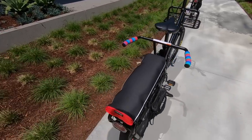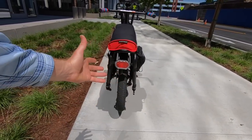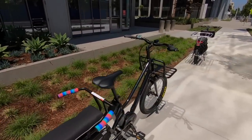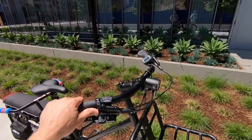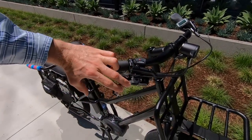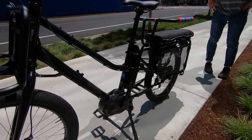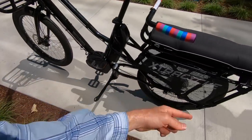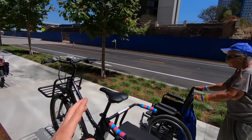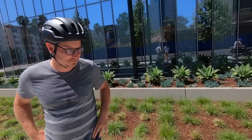Safety is a big deal to me. Having an integrated light that's fairly large with a reflective surface is nice. With the smaller wheel diameter, you're riding a bit lower — I wear a helmet with a built-in rear light for safety, and you might want reflectors on the back of a child seat or backpack, especially with a black frame. There's an integrated front light up high that points where you steer and has side windows — that's a really winning light. We've got hydraulic disc brakes, two-finger levers, 180mm rotors — and with a 24-inch wheel you get a nice mechanical advantage.